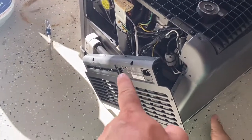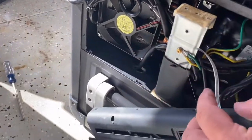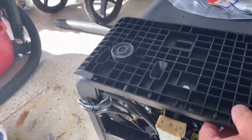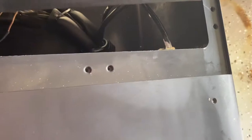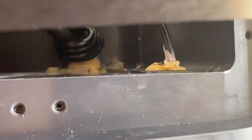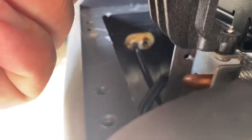Here's the back plate where your power inputs are, here's your fan with the evaporator, the compressor's right here. You have to pull this back and bend it a little bit to get access — that is just about as far as it will come out because it's still connected. You can see that little white goop and tan stuff — that's where the thermistors go. There are two holes, and the one to the right is the one I just took out.